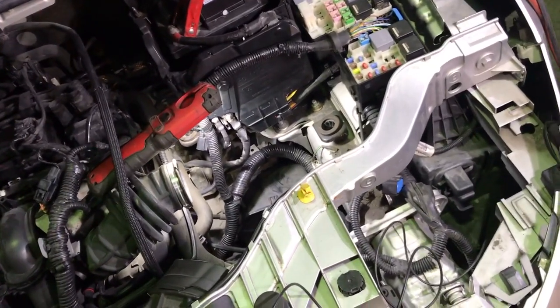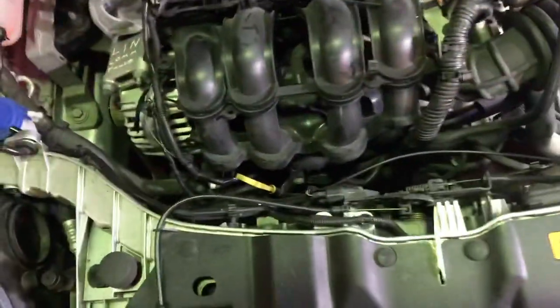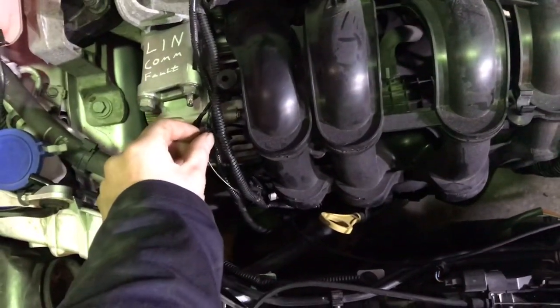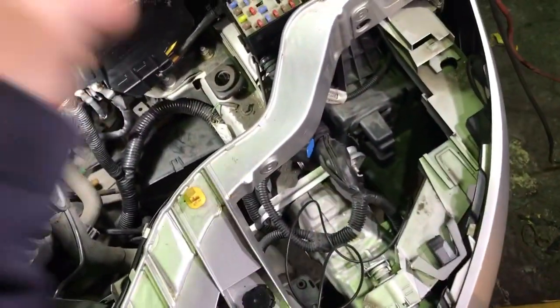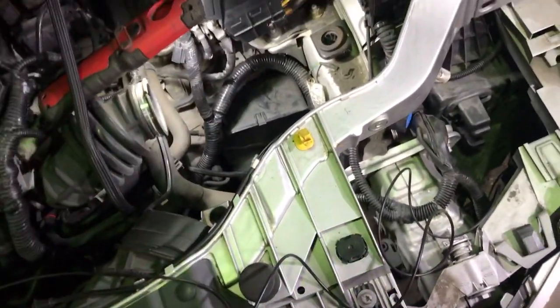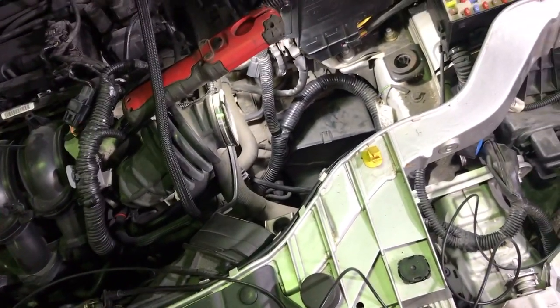In our case the middle wire at the grill shutters was zero volts instead of 9. What I had to do was bridge the LIN bus signal wire from the back of the alternator directly to the central grill shutter wire to bypass the rest of that section of wiring, because there was obviously a problem somewhere in it.